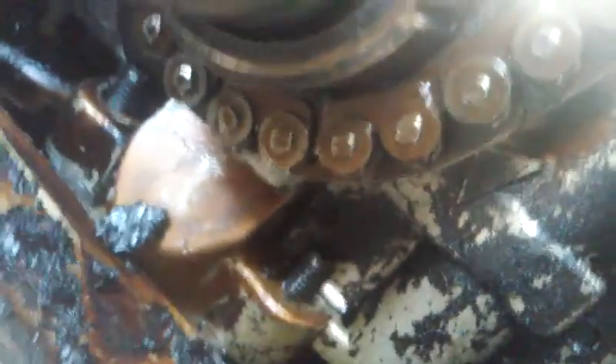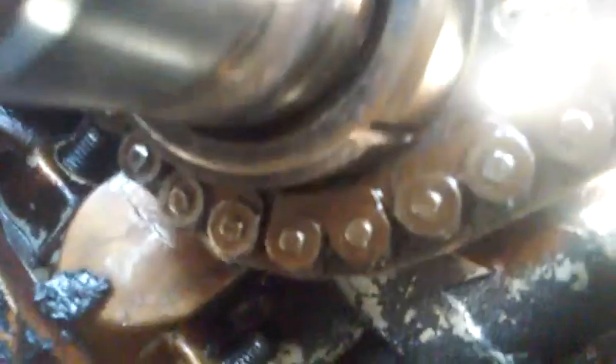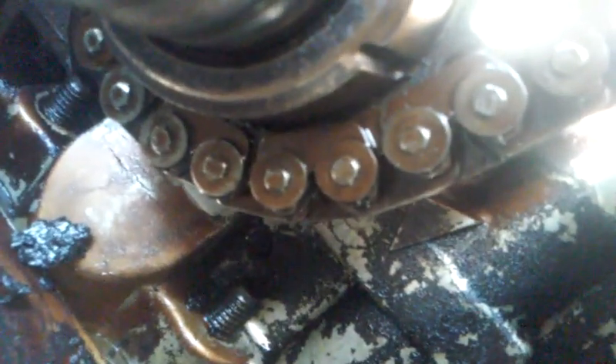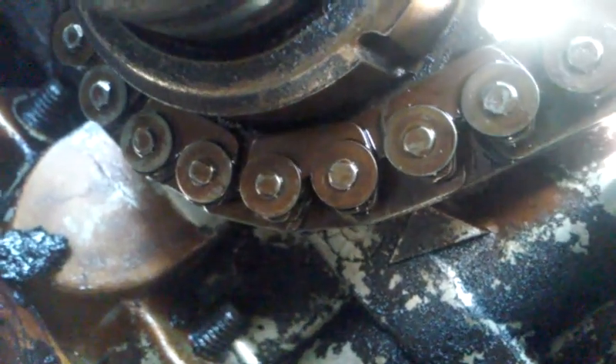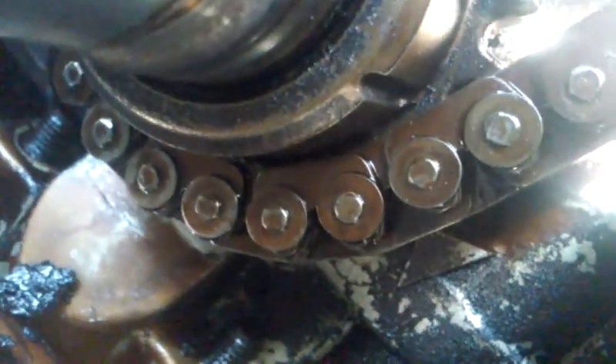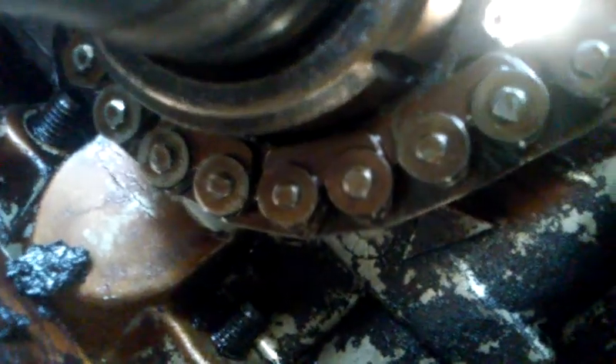You see that? And as you can see, I actually need to come down just a little bit more. So if you line up these two marks right here on the Chrysler 2.7, that'll set your number one piston at TDC. What confused me the most is that by aligning these two up, it actually sets the piston just a little past TDC — and that's okay.